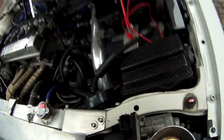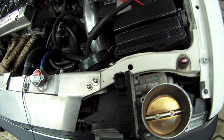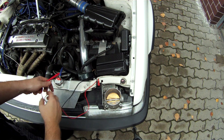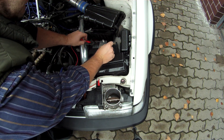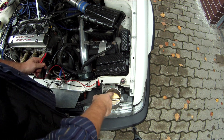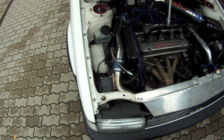You use these two upper pins to operate this throttle body in binary mode. By adding voltage to these two pins, the throttle body will be fully opened or fully closed. Let me show you how it works — fully open, fully closed, fully open, fully closed. Just remember it has to be sealed perfectly to hold your boost, so use the regulator screw and pour water in to check before proceeding.